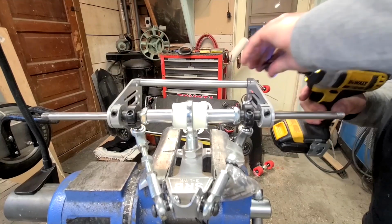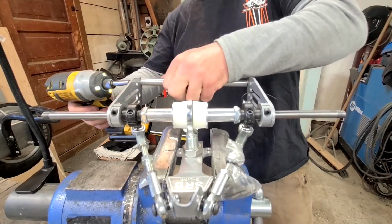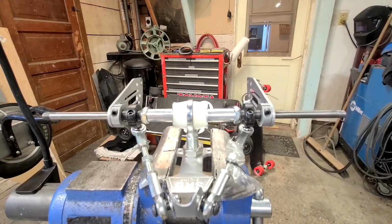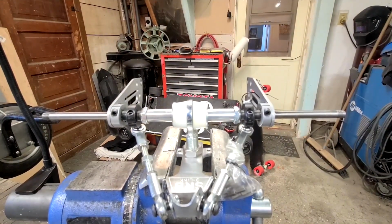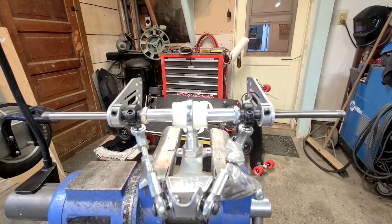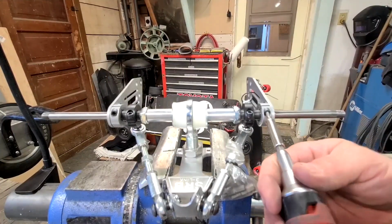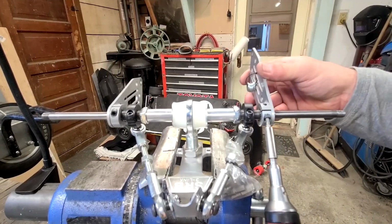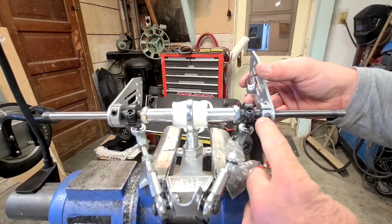I've heard riders describe the 3-link as turns like a dual kingpin with the precision of a reverse kingpin. With this truck, you can set the ride height, steering ratio, thrust angle, and track width for the desired target speed of your board. We built it for racing. We use the same truck for short track. We use it for uphill and long track racing.